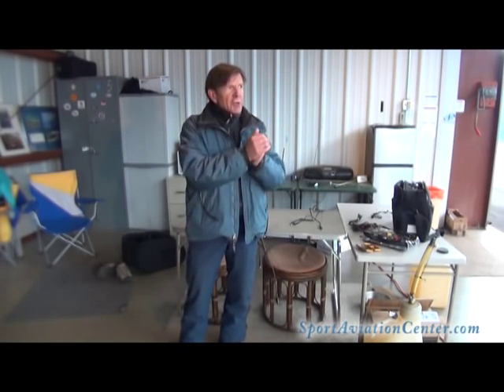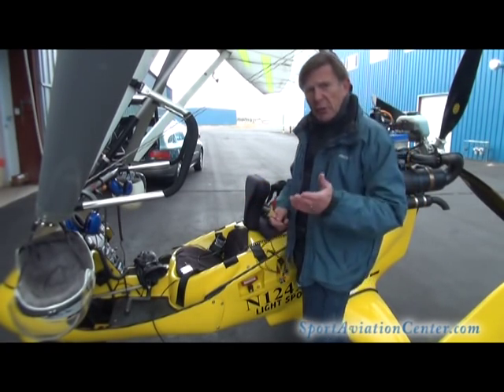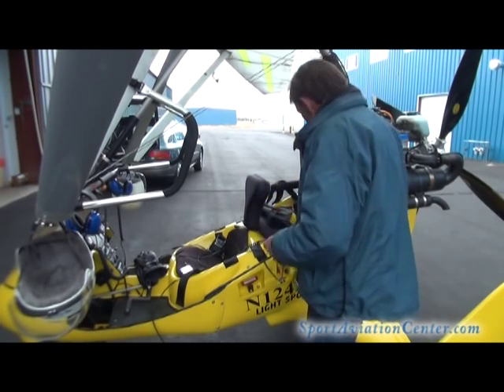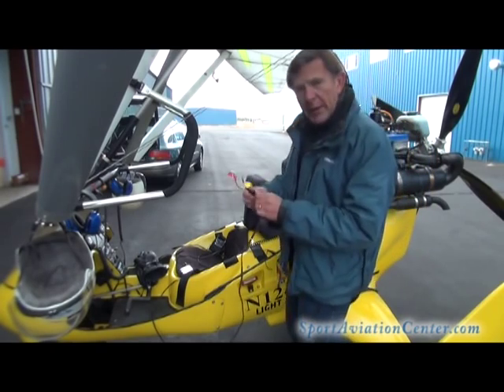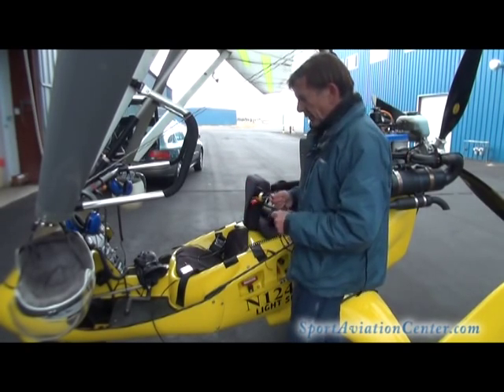Let's go into the trike and look at how this works, because you can only plug so much stuff in and you can take too much power. On the trike, what I did is I ran a completely separate circuit, completely independent of all the avionics, radio, everything here — completely separate. I looked at my battery and put a 20-amp fuse. I think a 20-amp fuse correlates to a 12-gauge wire. I ran that up through here.